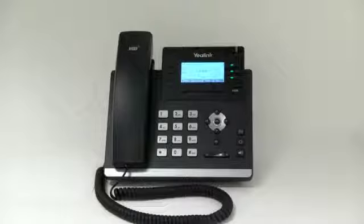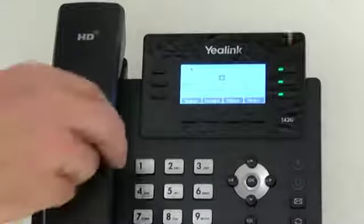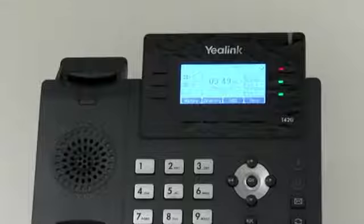You may ignore an incoming call by pressing the reject soft key, and the call will go to voicemail or find me/follow me if configured on your system. You may park a call temporarily by pressing the park button on the left side below the line appearance buttons. The phone will automatically park the call in the first available parked position. The shared park appearance button glows red, and the caller is now parked. The caller will hear music or a message on hold depending on how your system is configured. To retrieve the call, press the illuminated park position button.